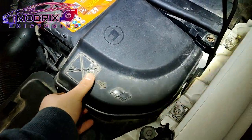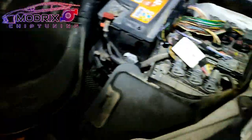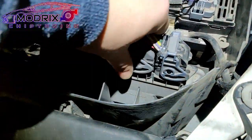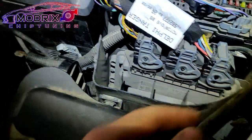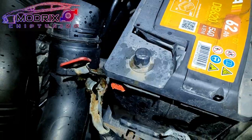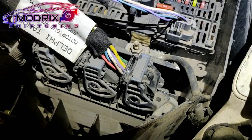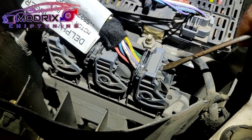Under this nice little cover — which you don't need to spray with the washer — here is the electronic control unit. You can pull it out pretty easily because it sits in here nice and steady. Just unclip those two, but before that make sure you remove this clip off, just like that. Now you can remove the ECU plugs with any screwdriver, just pull the little plastic clip in.